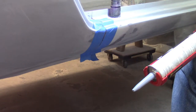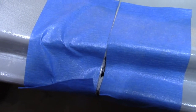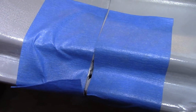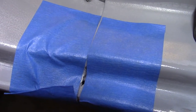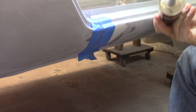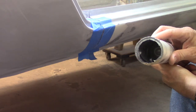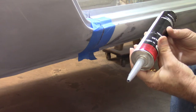Got the caulk gun loaded here. Again I'm going to use the caulk just into this big gap — you can see I do have a hole that goes all the way into the area between the sills, so I don't want water to get in there if I can help it. I'm going to get that and use the pressure of the caulking gun to fill that in. Well, that didn't work unfortunately. Even though I can put the little cleaner in there, I can't get any caulk out of this — it's backing up through the back of the tube and making an absolute mess. So I guess I'm going to have to stick with the regular seam sealer stuff. I did find this with the other tube too — it doesn't keep really well over time. So if you don't use most of your seam sealer with these caulking tubes, it's almost a waste of money.